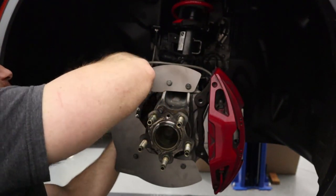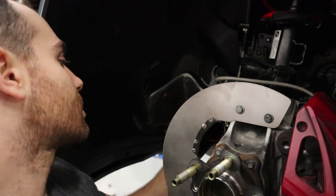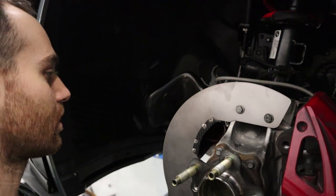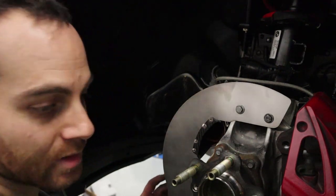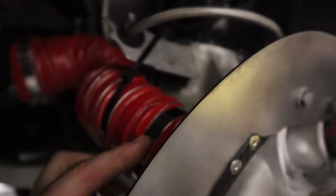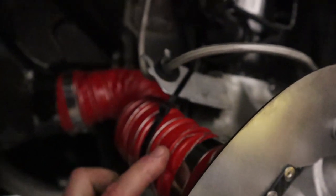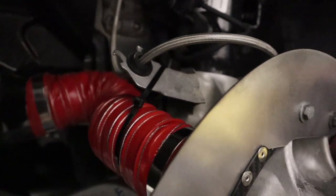There you have it — the hose is basically installed. At this point you want to make sure the car's suspension can fully articulate without pulling off the rubber hose or binding on anything — always a good idea. Everything has been installed, clamp is tight, and we installed a zip tie to help the hose stay in line with the brake duct. We do include those zip ties with the kit.